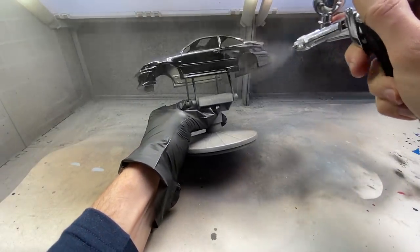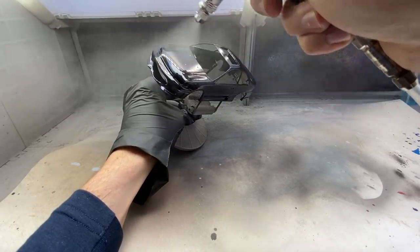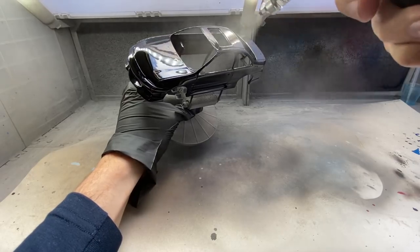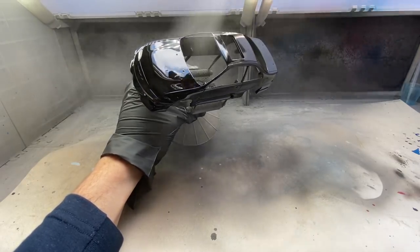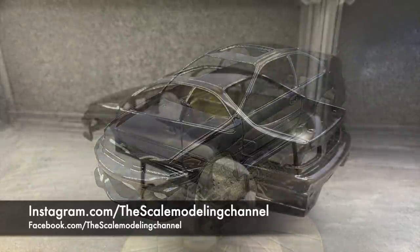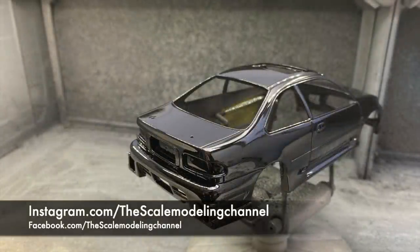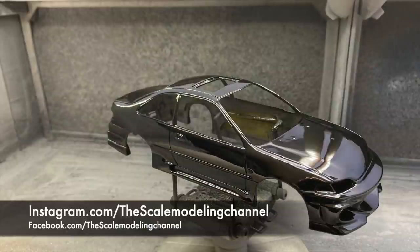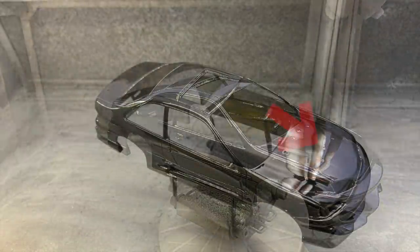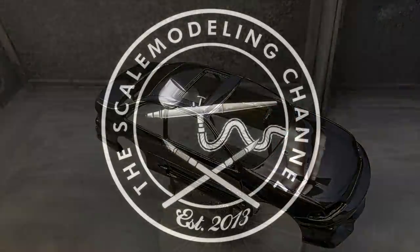After finalizing the second coat I was really happy with the way it finished. It did have a little bit of orange peel here and there so it requires a bit of sanding, and there is also some dust on a couple of the flat spots like the boot and the hood as well. That of course needs to be fixed, but in the meantime I'm just going to let it cure and then properly polish it in a further video for the series. In the meantime I will probably move on to the interior and also start to work on the chassis and figuring out the LEDs for the neon — again, if you have any suggestions on how to do that please leave a comment down below.